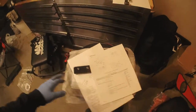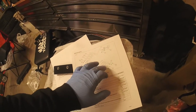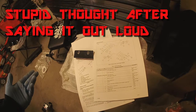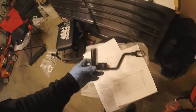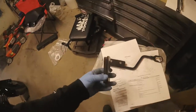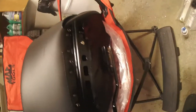For the actual bag bracket, this is where it gets confusing. Looking at the picture, it shows the spacers for the FXDF and the different length bolts — but do the spacers go on the outside or inside of the bag? I'd imagine they go on the outside to space out the bag. For the FXDF model, you have to use basically all three spacers: the two plastic ones and then the one isolator. This will definitely be a two-handed job — it was a little more difficult than it should have been. Having a friend to help is recommended.